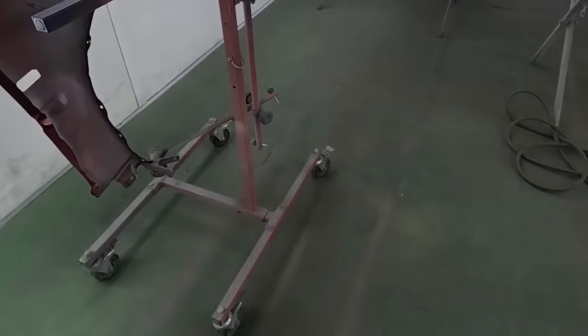First off, we're gonna clean up all of our marks from primer sanding, and then we're gonna go ahead and make sure that we get everything completely masked off. So now we're going over the process of how to mask the jambs. Now, every vehicle will be a little bit different based off how the body lines orientate inside a door jamb. But basically, we're lucky here because we're gonna do something that we most commonly don't do. We're not gonna do soft edge.